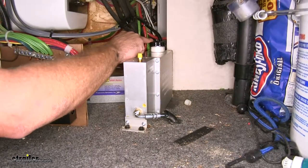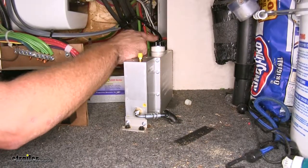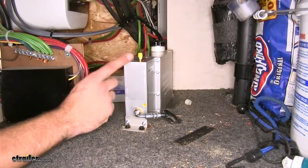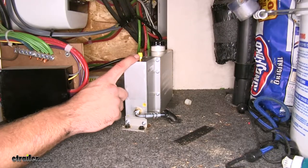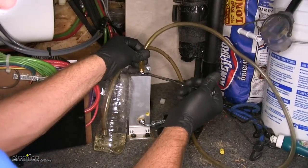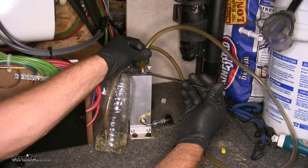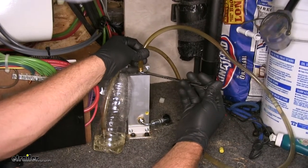You want to make sure that the cap stays open and accessible — that's where you'll fill the reservoir and maintain the brake fluid level. It also has a bleeder screw that's conveniently located, so you won't have to struggle to reach it. That helps us bleed out any air in the system initially or if we have to make any repairs down the road.